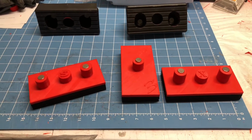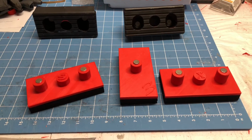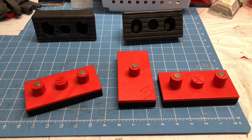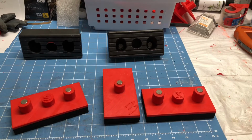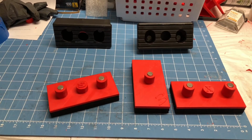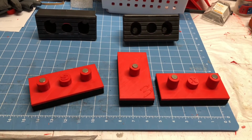You will need a good low profile aluminum floor jack. At minimum resting height, typically between 3 and 3.5 inches is a very good low profile floor jack. Because you have to take into account if that tire's flat, there's about half, 3/4 of an inch or so of distance that's going to be down with the flat tire. So you have to get a good low profile floor jack to do so. You're going to need a 21 millimeter protected deep well socket. You're going to need a good torque bar so that you can torque it down to 129 foot-pounds. You're going to need a breaker bar, and you're going to need a good pair of needle nose pliers to pop the little center caps off.